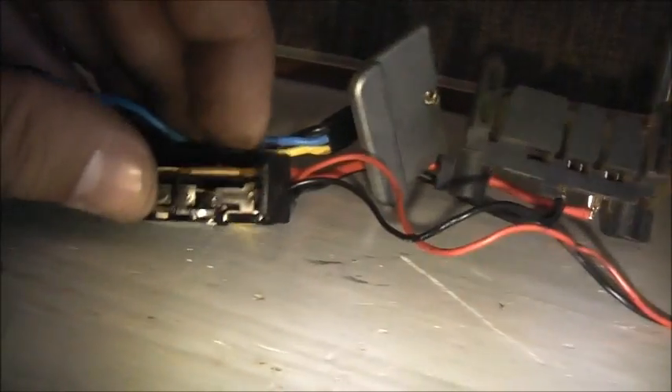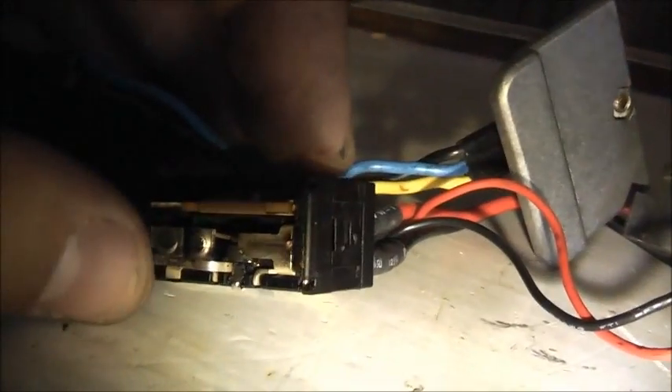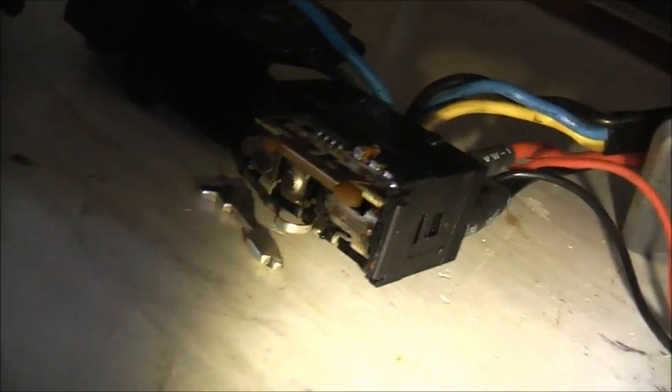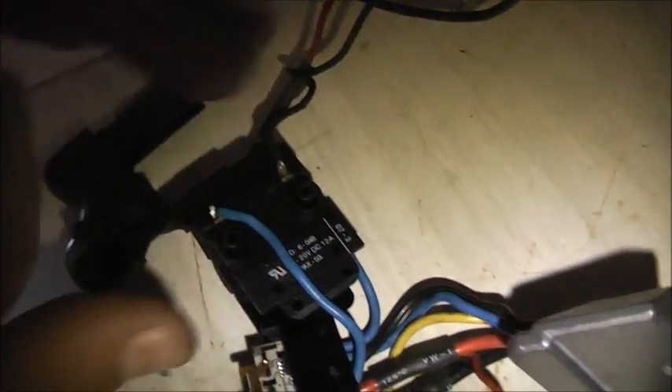I think that's all there is. The main contact in there is what I've overloaded. The top slider somehow went this way on that little spring, and it's lit up on those little contacts. There's something there to do the pulse width modulation when you press the trigger. Not a lot much inside these, but for what they do. And there's the switch for forward and reverse.